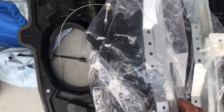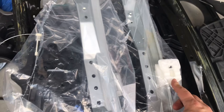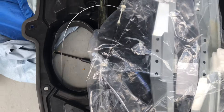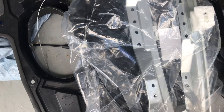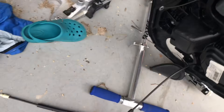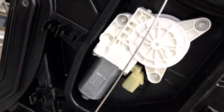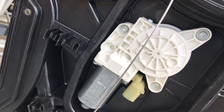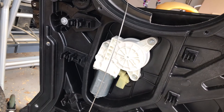I bought the replacement on Amazon for around 30 bucks. Make sure you get one that fits your vehicle — it comes with brand new window clips, which helps because one of mine cracked while being taken off. Luckily I don't need the old one anymore. To disassemble, there are four screws — use the T27 bolt — and then remove the motor. Hopefully your motor didn't go bad, but if you need a new motor this is how you'd replace that too. Take those three bolts off and the whole motor contraption comes off.